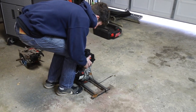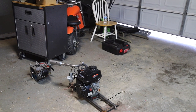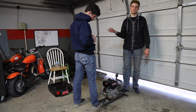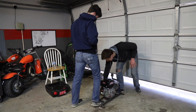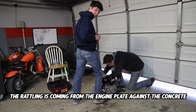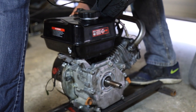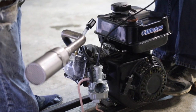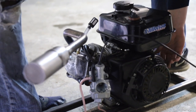We made a little engine run plate so we don't have to worry about it — put two nuts on there so we can stand on it while it runs so it's not rotating all over the place. Fill with gas and we're good. We turned the idle screw in a lot and then we'll back it off after it starts running. She's a runner boys! Yeah, so far so good.